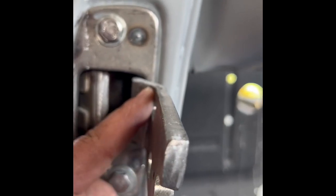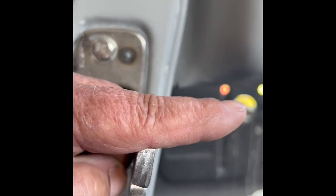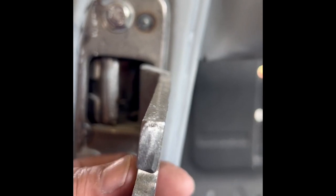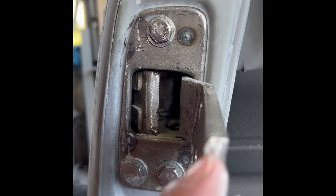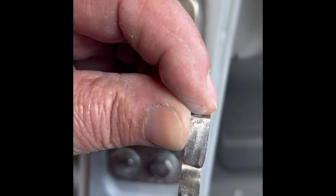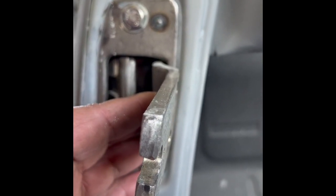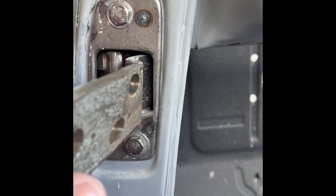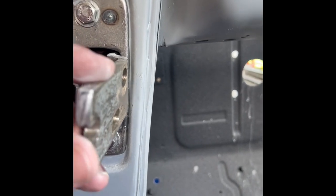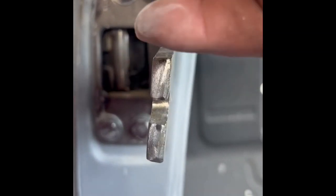The pivot of your door - how far it sits in and out - has to do with this area right here. If you bend this in, the door is going to sit deeper. If you bend it back, the door is going to sit shallower. That's almost 90 degrees right there. My door sits a little too far in, so I'm gonna bend this back a little bit. It doesn't take much because a small movement moves it a lot. Moving this area forward moves the door in and out - push this way to move the door out, push this way to move the door in.